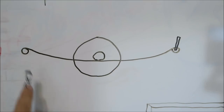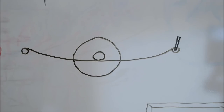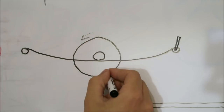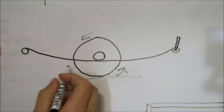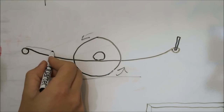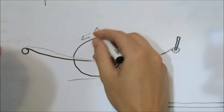So here's a basic leaf spring setup. You can see the leaf spring and shackle, the axle housing, and the outside of the tire. Here's how wheel hop happens: as you hit the gas to do a burnout or launch the car, the grip of the tire actually overpowers the leverage of the leaf spring. As the tire starts to rotate to move the vehicle forward, that grip overpowers the leaf spring, which makes it want to bow up like that, causing the suspension to physically unload.